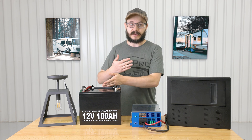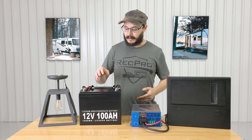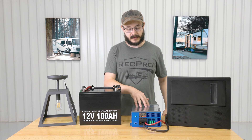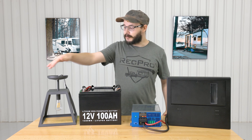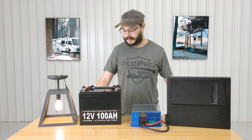That DC power then flows to your battery or to whichever appliance you're going to use. When you're not connected to AC power such as shore power or solar power, the power stored in your battery is used — it flows back through your converter, back to the breaker box, and then around to whichever appliance you're going to use. It's very simple.